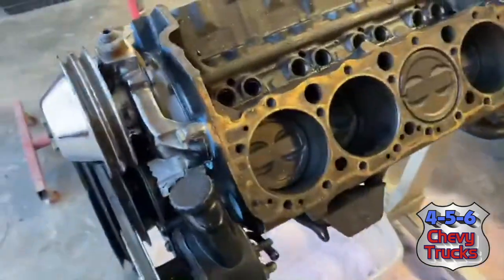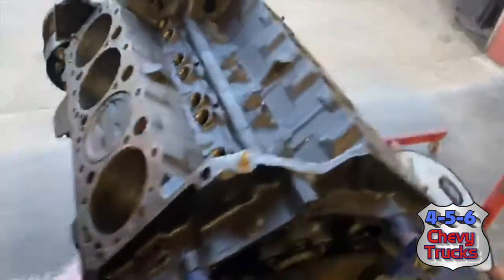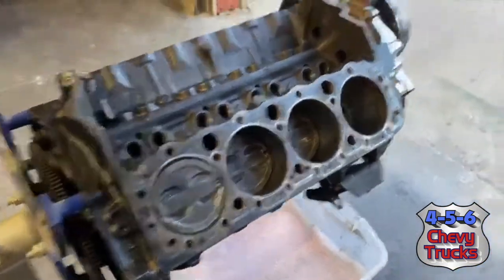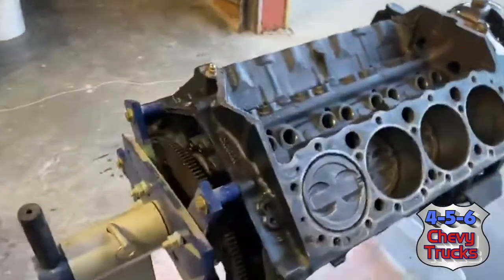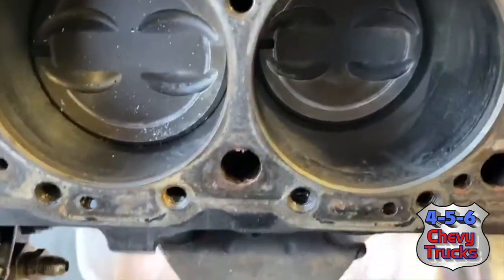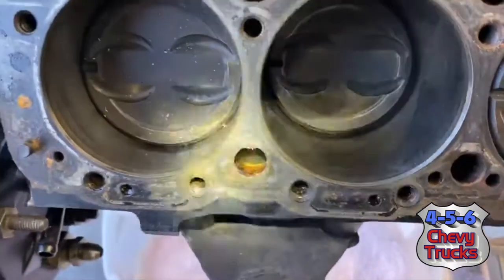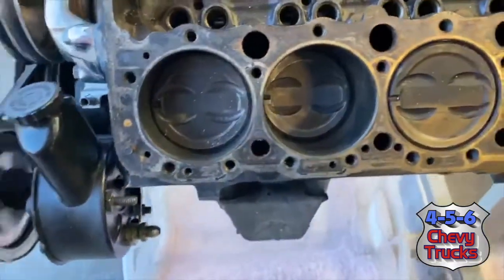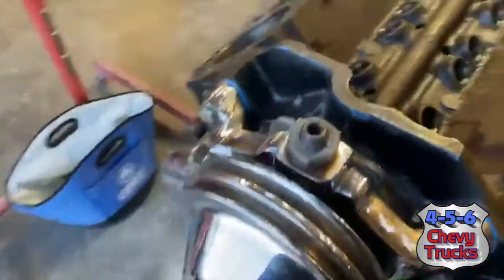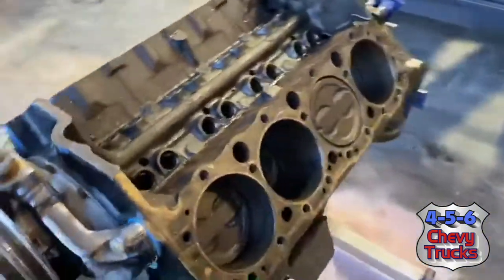But I'm gonna say this block does not have any internal water jacket breaches. As you know, water travels the path of least resistance. So I see nothing that would indicate any seepage in the cylinder walls. This one here, I did spill just a little bit in the bottom of that, but I dried it out. So if in fact there are any breaches, hairline cracks internally in this cast iron GM crate motor block, it'll manifest itself overnight because that water will find its way to daylight.